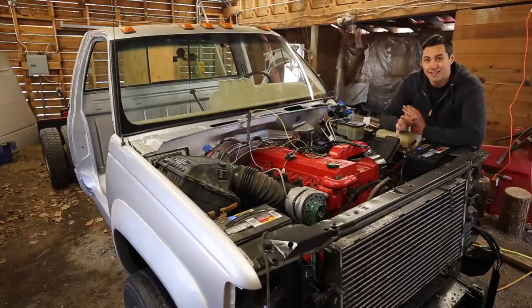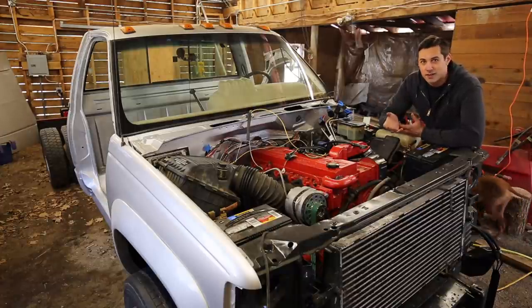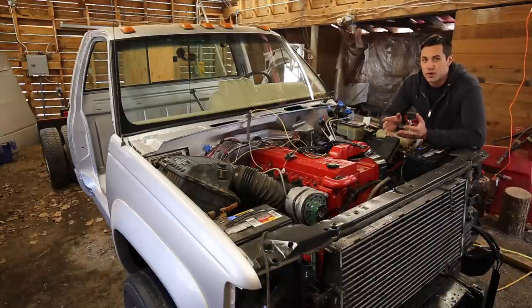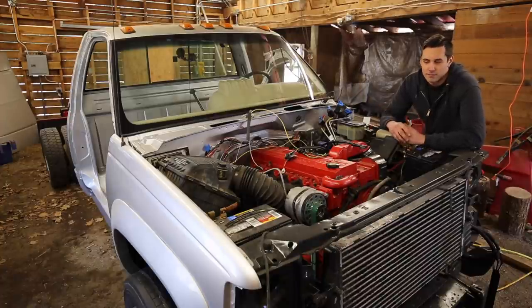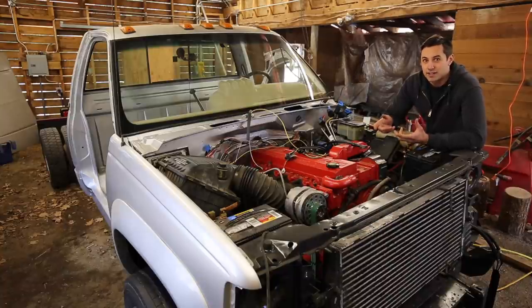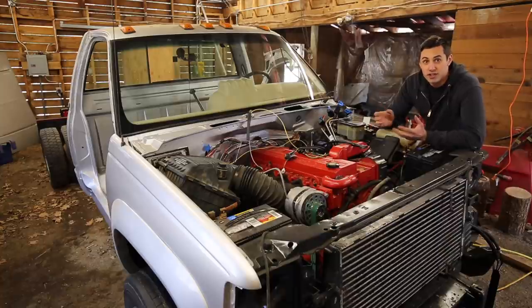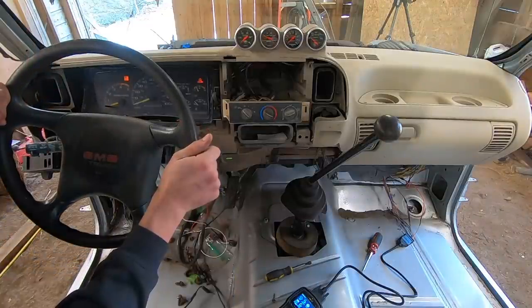It is the next day. Not only did I charge the batteries overnight, but I also found an issue that would definitely prevent it from starting. I noticed on my OBD2 scanner that while cranking the engine it read an RPM of zero — obviously that doesn't make sense. In order to determine RPM the computer uses the crankshaft position sensor, so that's where I started looking. I unplugged the sensor and noticed the contacts were quite dirty from sitting unplugged for a while. I cleaned them off, verified that the sensor was getting ground and plus five volts as an input, plugged it back in, cranked the engine, and the OBD2 scan tool did show it was reading an RPM. That fixed the issue — so now I just have to crank it some more and hopefully it'll start.